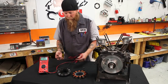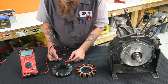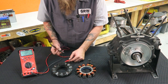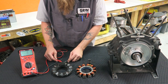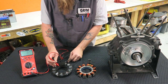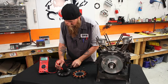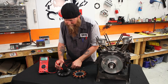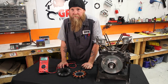Now this is a sealed unit and we'll do the same checks here — check continuity and get a resistance reading. There's 0.1 — that looks like a good stator. We'll do the switch like I said, just to double check. Then we're going to pull one meter lead and go to ground. You can see instantly we have continuity between leads — and just for the hell of it, let's check the other side too. Right off the bat on a static bench test, you can tell that this stator is no good. Anytime you have continuity between one of the full phase wires and a ground, it's no good.